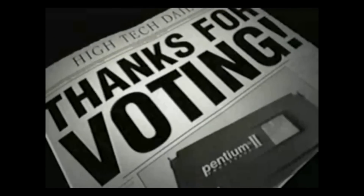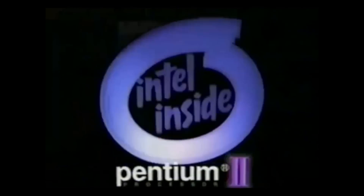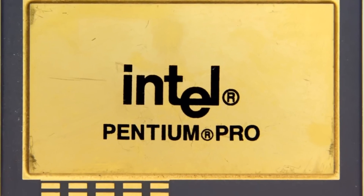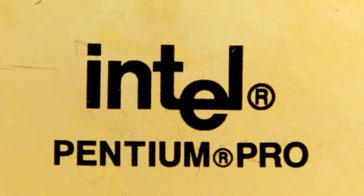The result of this is you can't design a motherboard for a Pentium 2 that contains any cache. The Pentium 2 has a built-in 512K of L2 cache, but that's it. It also has more L1 cache than the Pentium Pro — 16K of data and 16K of instruction cache for a total of 32K — but that leads to an interesting comparison. Some Pentium Pro motherboards had room for a megabyte of cache, so you can benchmark a Pentium Pro at 200 MHz versus the Pentium 2 at 333 MHz, and the Pentium Pro can actually be faster because it's got 1024K of cache versus the Pentium 2's half megabyte.